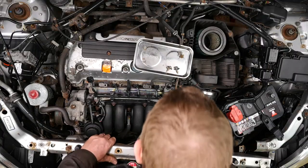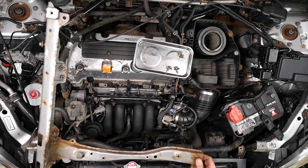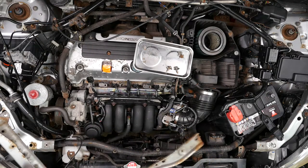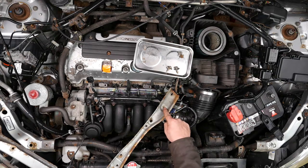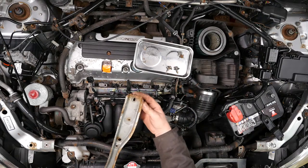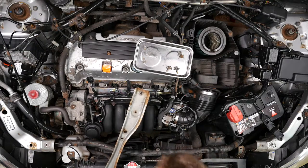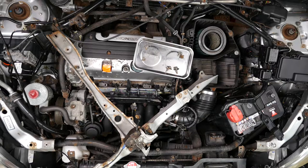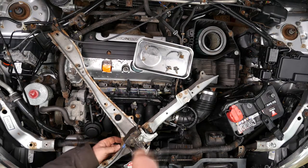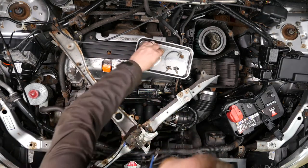The bracket is now free to come out, but the cable is still attached for the bonnet release, so we will take that off as well. Looking at the centre part of the bar you can see the little holes where the wiring loom attaches, and at the bottom there is some welding — that's the hole where the other bolt would have been. You probably don't need to remove the bonnet lock, but since the cable is attached and it's quite a big piece of metal I will take the lock off so I can put the piece of metal outside.